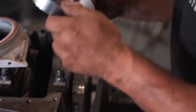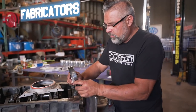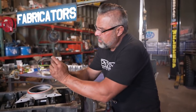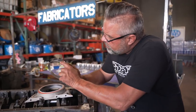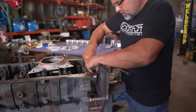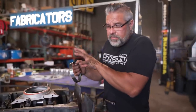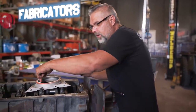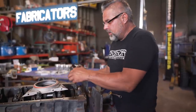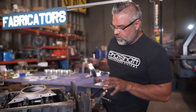If you don't have the tool to apply this, this is the only way I can think of. What I'm gonna do is put this back in the oven, heat it up to a couple hundred degrees — maybe three to four hundred degrees — then slide it on there and let it cool down. You can see on here that this is tapered right here and then flat here, so when you put it on, I'm assuming you'd want to put it on this way so when you go to put the seal back on it slides on easy. These bigger ones are easier than the front one — the front one is really tough — but hopefully this rear one will go on easy.